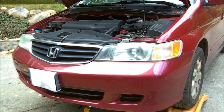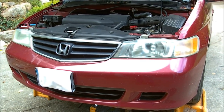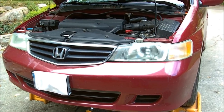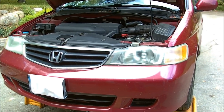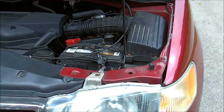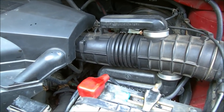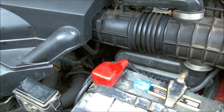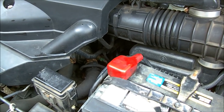We have 230,000 miles on this one. We've had the transmission rebuilt about 100,000 miles ago. Lately we have a check engine light; the trouble code is saying torque converter. I had it in the shop and was basically told the torque converter is going. Driving symptoms are agreeing with the torque converter issue — we have a high rev without power between second and third gear, a check engine light, and a traction control system light coming on.